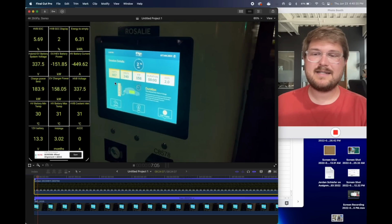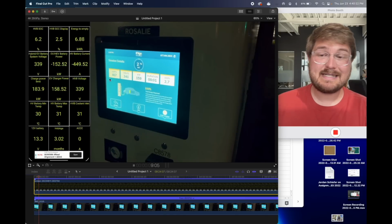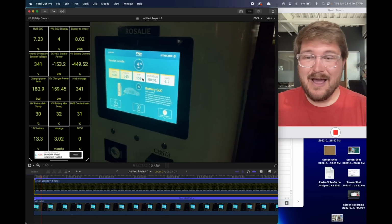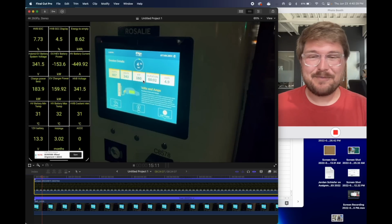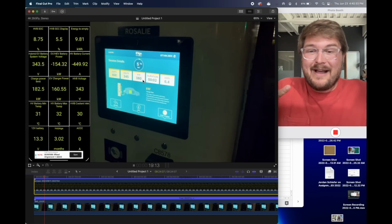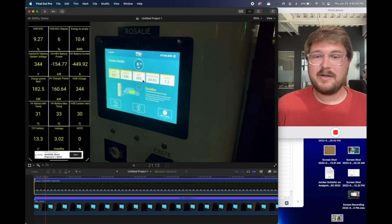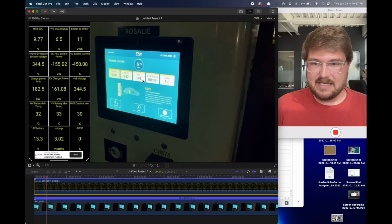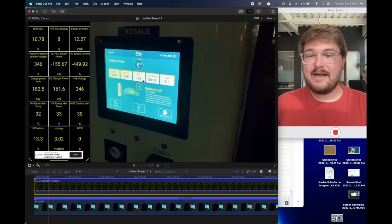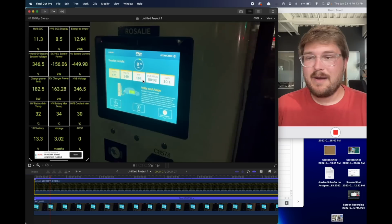Look at this, 468 amps being delivered to the truck. It is just juicing that thing. But the voltage is so low that the total power is only 160 kilowatts. So this is where having some more pack voltage would really help the charging speeds. And that's just an inherent disadvantage to the F-150 Lightning. I think there's no other way of putting it.